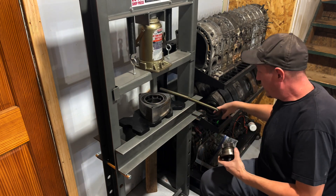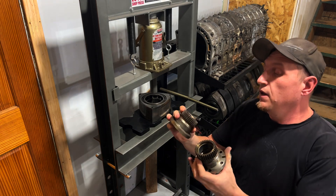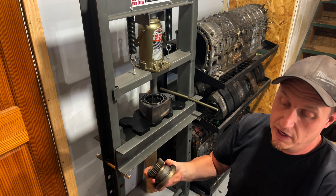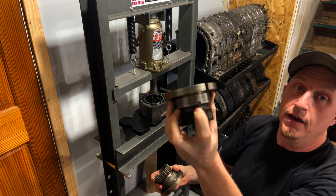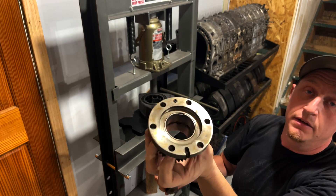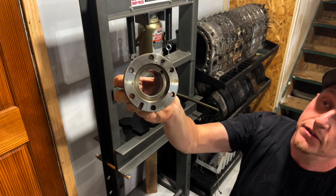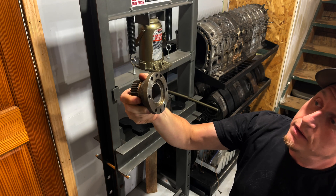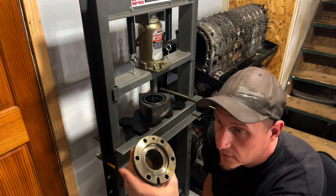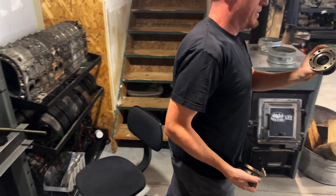On to our stationary gears. There are two different types of gears — for the front and the rear. Anything from '93 up has a little screw that holds your stationary gear bearing in, because it's a journal bearing. The older ones have the same notch as the rotor bearing. With that notch, same deal — you've got to push it out the other way.